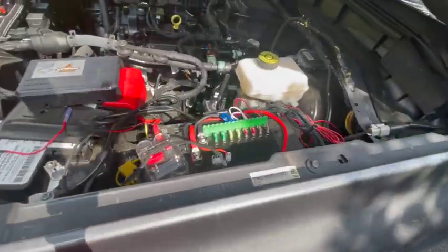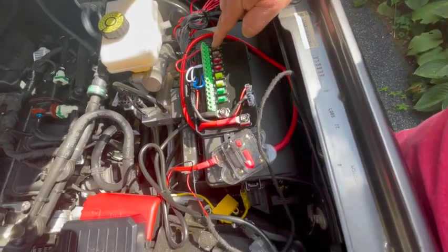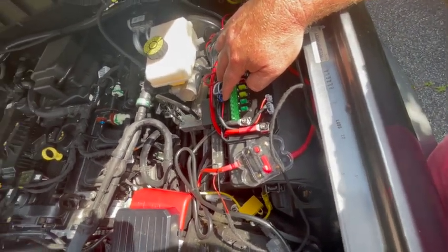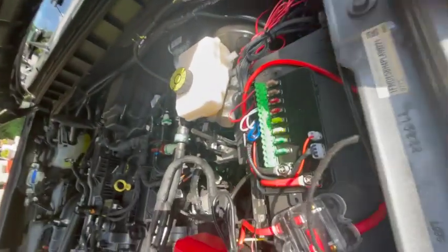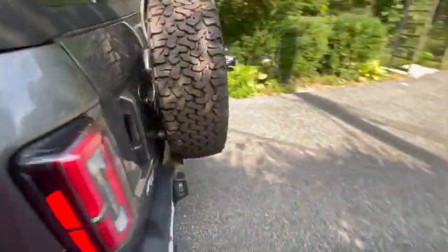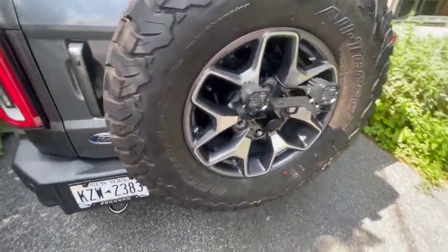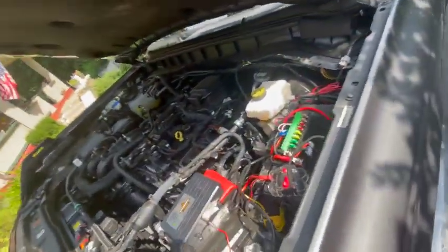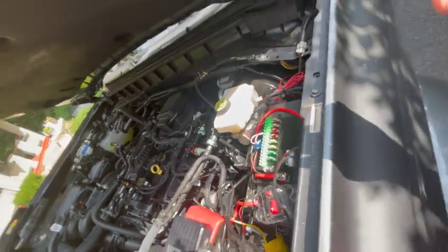Here's what the inside of my aux beam switch looks like - I've got two, four, six, eight switches. Right now I've got a DRL and a pod light switched individually so you can do low beam or high beam on that, and I've also got my rear tail lights hooked up to another one - those will be either red backlit or bright white when backing up. Now I'm going to add the Bronco letters to either the five-amp or ten-amp slot.